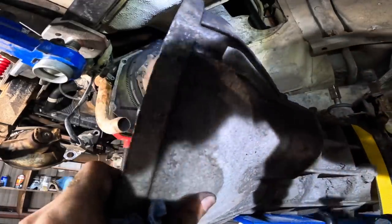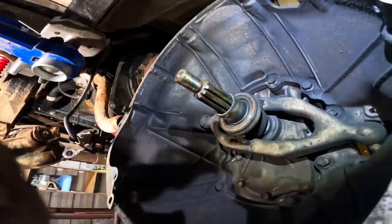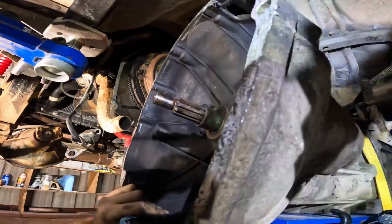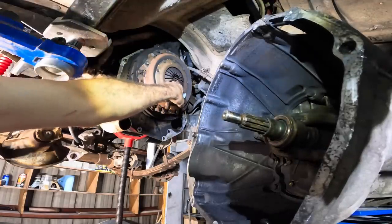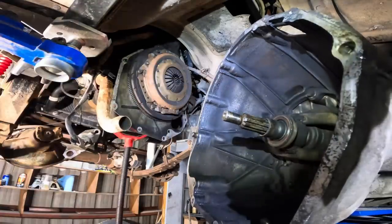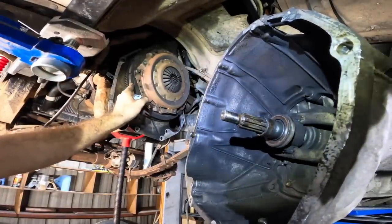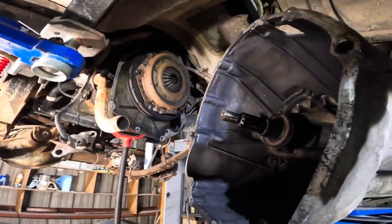Let's spin this bad boy around and see what we got going on for a throwout bearing. Oh yeah. So you've got your lever right here — the slave cylinder acts on this lever, pushes that direction when you actuate the clutch, that pushes on this bearing, and that bearing will press on these little fingers here on the clutch. You see the marks where it touches it? It'll press those springs in and that will release the clutch from its pressure on the actual clutch material. When you release it, these springs release and then pressure is reapplied. The clutch is splined to the shaft on the trans, the basket is bolted to the flywheel. When it's released, it creates a mechanical connection between the two units; when depressed, it separates that mechanical connection. Pretty fancy, right?